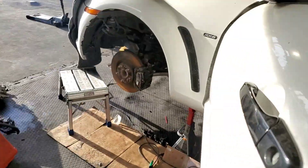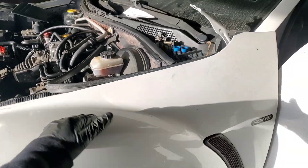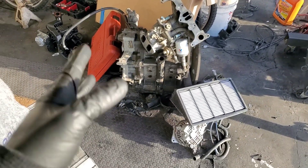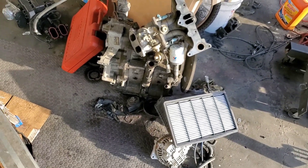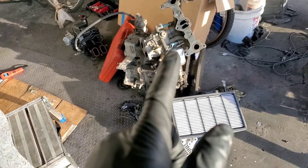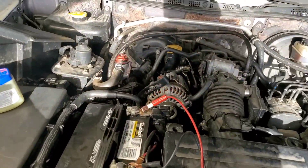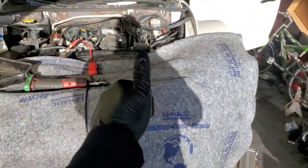That's all the coolant, exhaust, and oil from the used engine burning off. I'll tackle that now. If the owner is going to donate this engine, I'm going to open it up, drop in some apex seals, corner seals, and Goopy Performance parts, put it all together — it's going to be a giveaway. I'm going to add the coolant and we'll go from there. Thanks for watching, stay tuned for more videos.